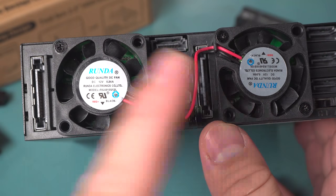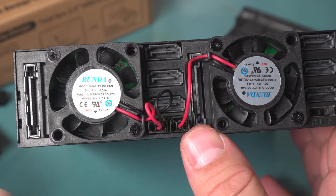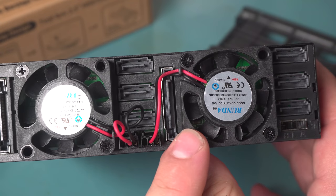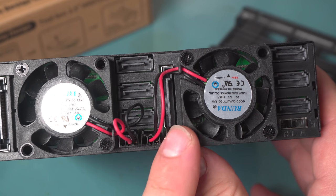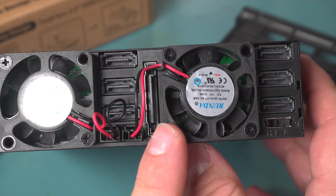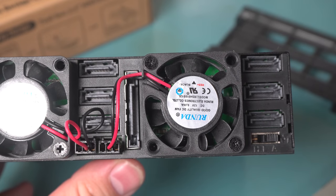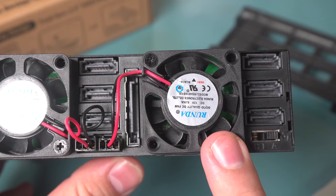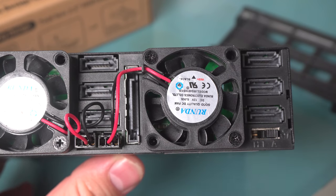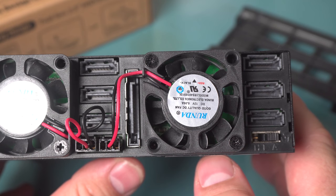One SATA power connector will power all the drives — I'm not sure if it would do it reliably with six hard drives, but the drives do work with at least one installed per slot. However, all the fan control is handled by this SATA power connector, so you basically have to fill this side first, or at least power it no matter what. I'm only using two drives at this time in my server, so I'm going to be powering just this side to get the fans going. I'll probably disconnect the secondary fan, and I'm going to switch these fans to exhaust — they're currently set to intake air through the caddies, but there's no filter on that.